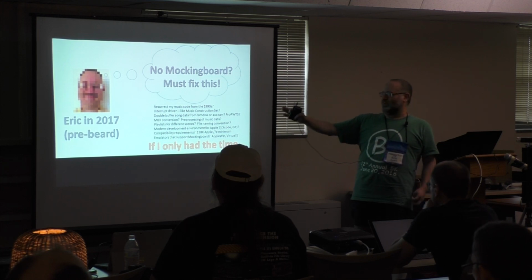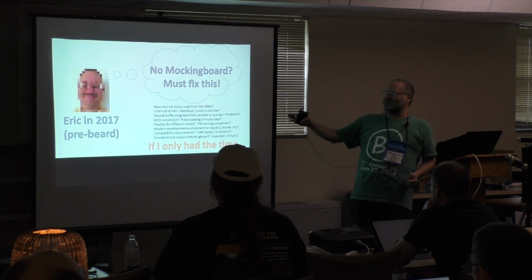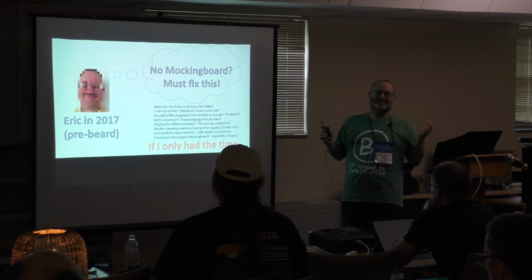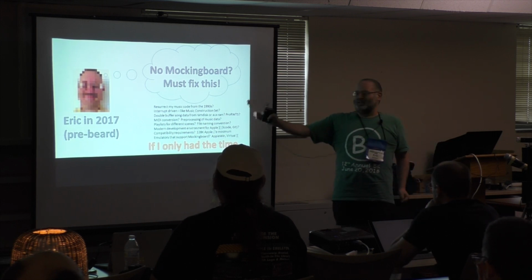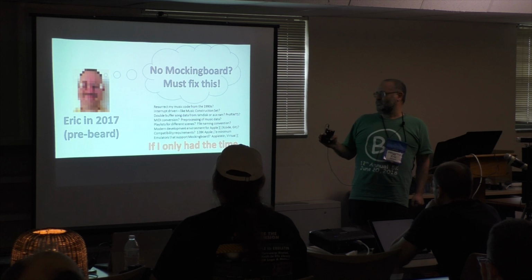I was thinking we could double buffer song data from a RAM disk or auxiliary RAM, and ProDOS has features for bringing in segments of memory, but ultimately there is a noticeable delay when you're reading even from a RAM disk. We could try to make it better, but we want to fit into a standard 2E with 128K. But MIDI conversion turned out to be part of the method for producing the music.